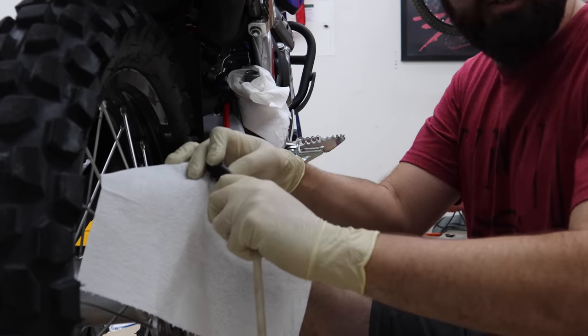I didn't really mention it enough in the video — the front brake on this bike, I think, is pretty bad stock. It got a little better as the pads bedded in, but they put way too weak a brake on here. The rally version of this bike has a bigger rotor, which shows just a little bit of a bigger rotor could have done. Between the steel-braided line, CoreMoto, and the Warp Nine Supermoto front brake, plus deleting the whole ABS system and having direct control over the brakes — we've gone completely the other way. These brakes are awesome now. This is the kind of stuff I love — it makes the bike more enjoyable to ride. Dash is visible, brakes are good, no stupid buttons. So many wins over these last two videos, and now we can do the Supermoto setup.